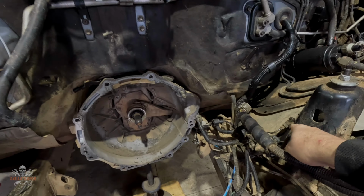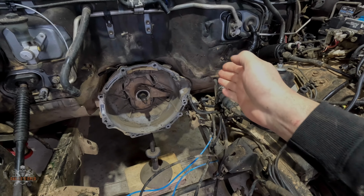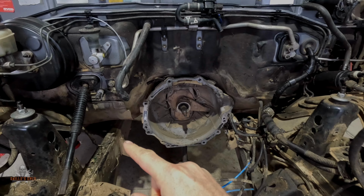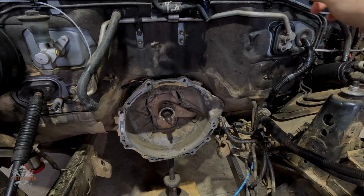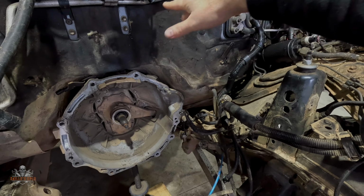What I want to go through actually is to show you just how little connects a body to the chassis on an 80 series. We've got the clutch, right? The clutch, which I've taken off now because the slave cylinder is moving from the passenger side to the driver's side with the VDJ. So that's connected to the body, to the chassis there.